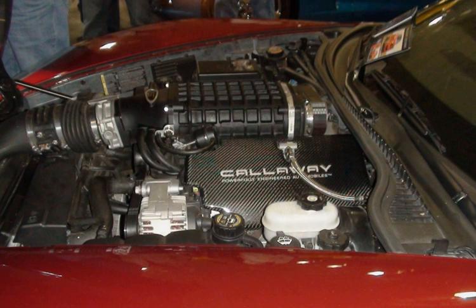The Vortec HO 6000, or Vortec Max, is a special high-output version of the Vortec 6000 V8 truck engine originally designed for Cadillac. This engine was renamed the Vortec Max for 2006. It features high-compression 10:1 flat-top pistons for an extra 10 hp and 10 lb-ft (14 Nm), bringing output to 345 hp and 380 lb-ft (515 Nm). LQ-9s are built only in Romulus, Michigan.